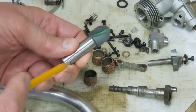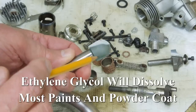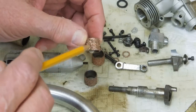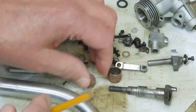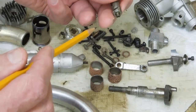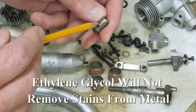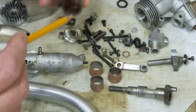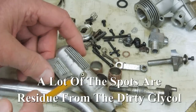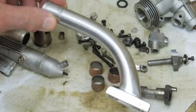The grizzly drum sander is pretty well cleaned up — this little bit of remaining stuff will come off when I wash it in soap and water. Keep in mind that glycol is a solvent; it'll remove paint and powder coat. These carbide cutters — a brass brush or a toothbrush will remove this little bit of stuff that's remaining. These look almost like new. You're not going to get rid of staining — like this carburetor is a bit stained on the metal. When I scrub that with a toothbrush and soap and water, that'll clean up a little bit. But discoloration that's in the pores of the metal, you're not going to get rid of. We got all of those deposits off this muffler, but probably some of this staining will remain. This header looks almost like new.